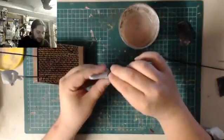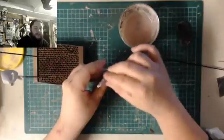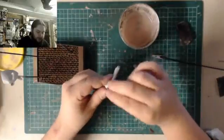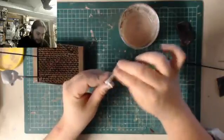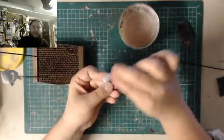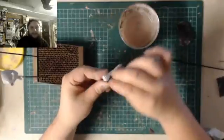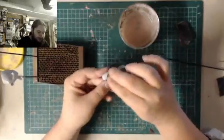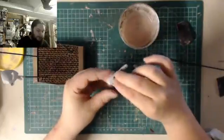And even if you don't see any imperfections, it probably doesn't hurt because there is some roughness or texture going on that the human eye can't see. And just giving it a quick rub down like this never really hurts anybody. And then you do that, paint, clear, sand, paint, clear, sand, paint, clear, sand, and you get an absolutely wonderful finish. Just be very patient, take your time, don't rush any of the steps.